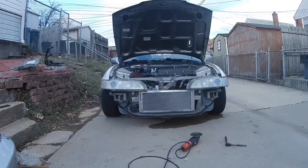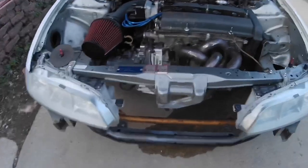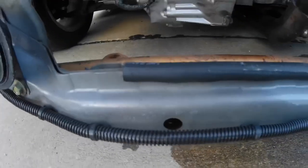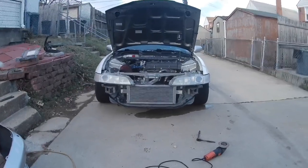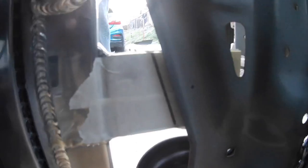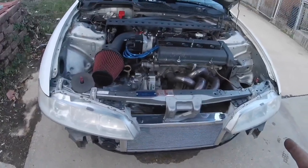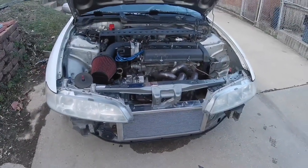I want to figure out where to drill holes in the tabs to mount this radiator. I'll flatten out the cut piece a little more, put paint on both cut pieces, and lay a strip of rubber across so the radiator sits on top of it. I have it lined up centered, and on the inside brackets I'll put some tape and mark the line on both sides. I'm going to drill a hole into the actual core support and mount it up with some pretty big bolts, then tug on it to see if it feels strong enough — if not I'll add a second bolt on each side.